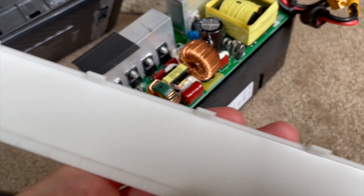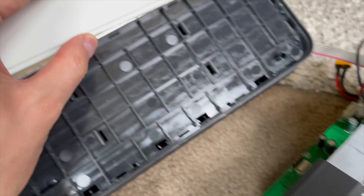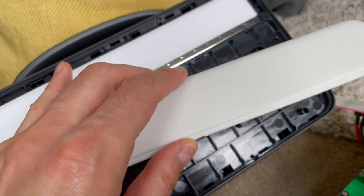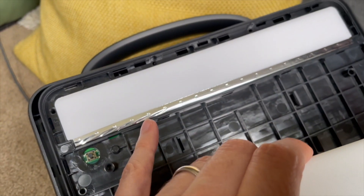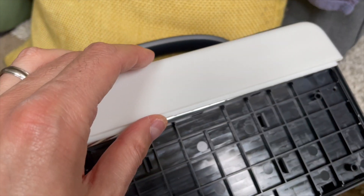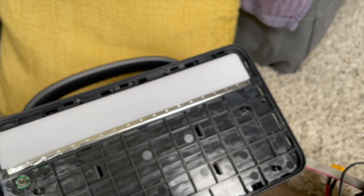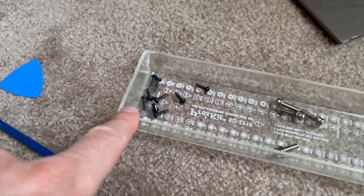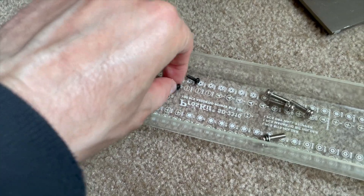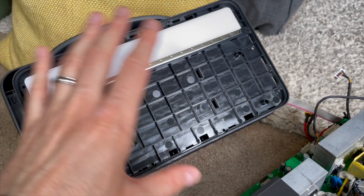Once the back panel was off, I worked on getting the LED cover off as well — that one was easier, held in by only five clips and one on each side, with the bottom open. You just gently push it away and lift it from the LED. Be careful not to lever onto the plastic and damage it. Once you have that out, there are 10 security Torx screws — it is a T10H.